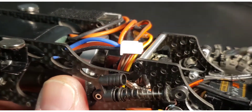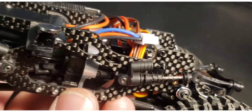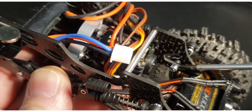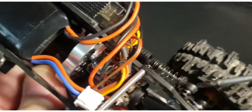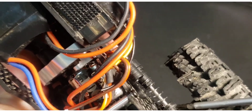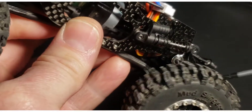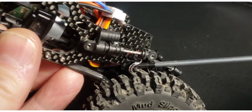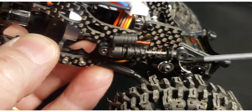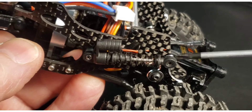The carbon fiber is a dense visual field so it's hard to make out the parts — sorry about that. You can see the silver lock nut here, and the pivot bolts use the longer of the screws for the actual pivot axle. You get four screws that are longer and ten shorter screws. The four longer screws are for each of those pivot points.